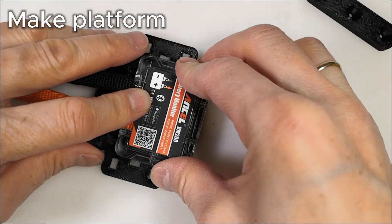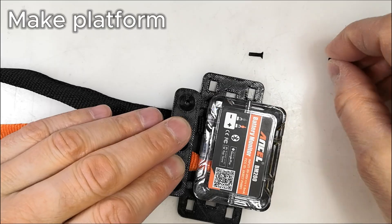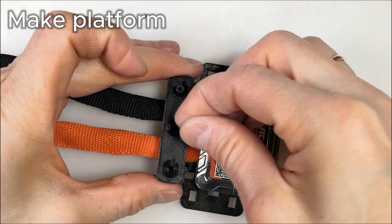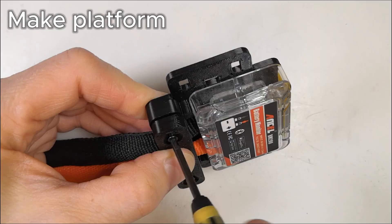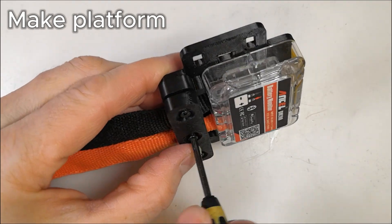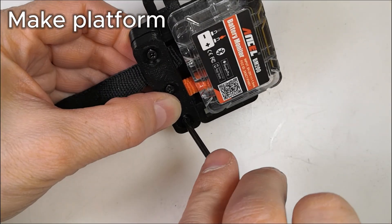The casing is quite flimsy, so I'm building a solid mounting base. I'm also adding proper cable strain relief. The manual says to mount the unit to the battery with double-sided tape — that's not a good idea. During service, replacing the battery could become difficult. With a separate base, I can mount the unit to the battery cables instead.